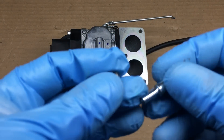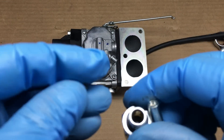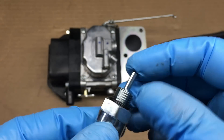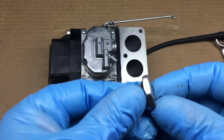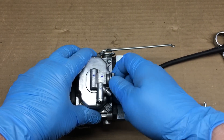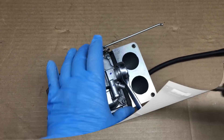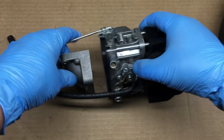Like I mentioned previously, this solenoid's been disabled. It originally had a spring and plunger in it, and the purpose of the solenoid was to prevent backfires in the exhaust system when the engine was shut off. We don't care about that. So this solenoid plug will make getting the carburetor on and off the engine so much easier. I think at this point we've had to remove the carburetor at least 10 times now in order to do the modifications to the jets and whatnot, so for me it makes a big difference.